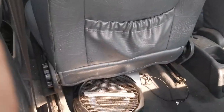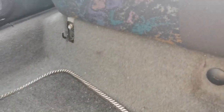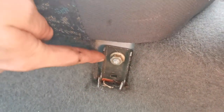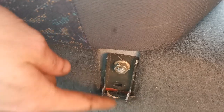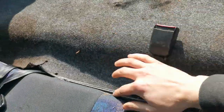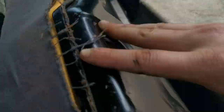I've just pushed the front driver's and passenger seat right forward to expose these bolts. Now I'll show you that one - you can see that clip there with what looks to be a 13mm bolt. You would normally undo that bolt, drop the seat forward, undo that bolt and that would come off, and there's another 13mm bolt just here as well. That would come off and that's how you undo the seat. You would literally just drop all the seat belts out the way and lift that up out of the way, rock forward, go down in the gap, undo the bolts and then that would come out. But as you can see it is completely snapped off and the brackets are gone.